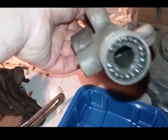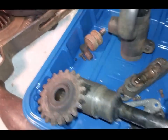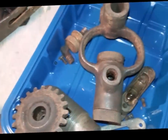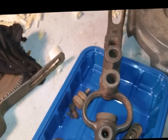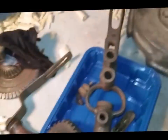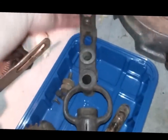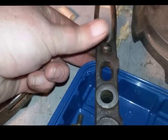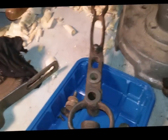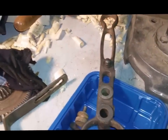We're only one short for the bottom, just like I thought. There's the one bearing — so we're one short for the bottom. I'm going to get the opportunity to clean these and reassemble with copper grade grease, and we'll see what happens. This is the first one of these I've had to take apart. This one also has a little trolley wheel on there, and it moves fairly well, so I think I'm just going to clean that up and oil it rather than take it apart.